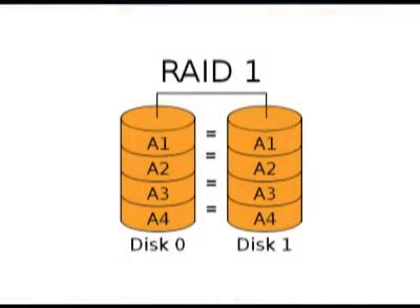Now if you did want to protect your information, you would use what's called RAID level 1, and that's mirroring. What that does is it writes the same exact information to both drives at the same time. If one of the drives dies, you can just put another drive in there and it's going to copy the information from the first drive onto the second drive.